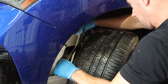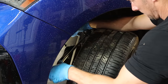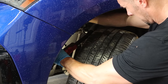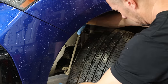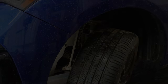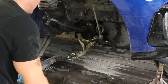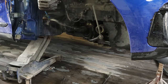We got the bolt out of the subframe — now we need to pull it out of the bushing but we don't quite have enough room, it's hitting our sway bar. So we're going to disconnect the sway bar on the driver's side — that'll allow us to move it up a little higher so we can get that bolt out. Just put a pair of vice grips on the back of it, break it loose, then get the power tools. Flip our vice grips, push it out of there, slide that sway bar up, and we got our bolt out. Now we can get our lower control arm with our custom caster adjustment out. Bust that in the pile.